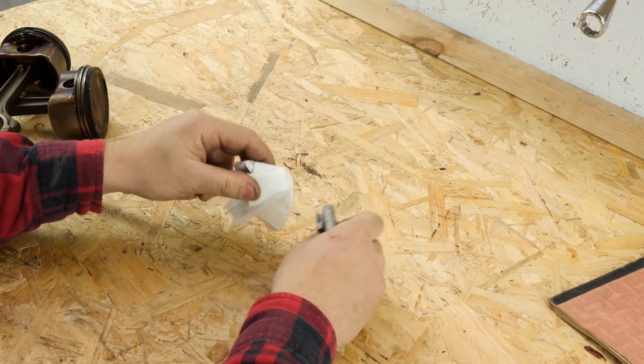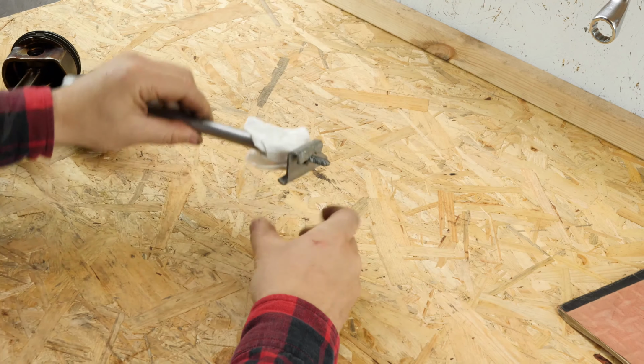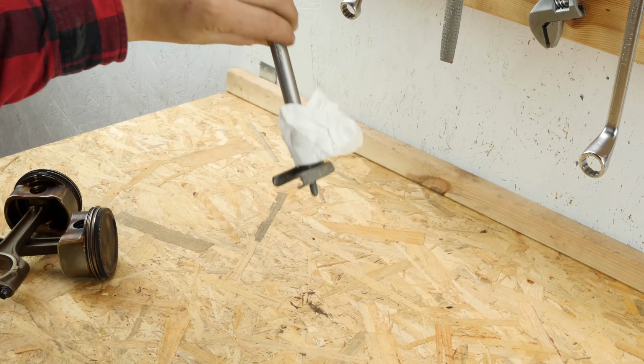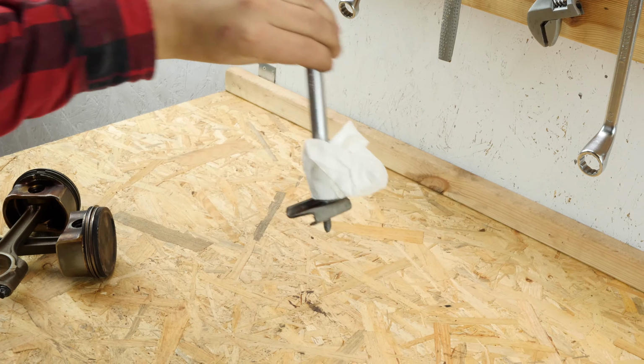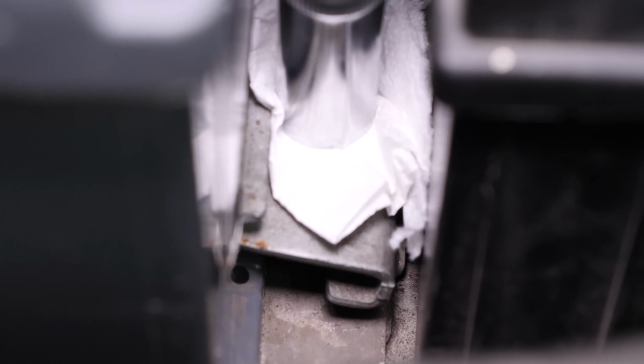Take a piece of paper towel and fold it in fours. Lay it flat on the socket, then insert the head of the nut, forcing it into the socket. Magic! It holds all by itself. By only using the extension, you will be able to screw the fastening plate back in place.